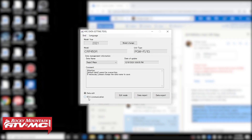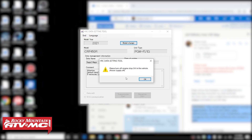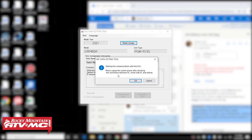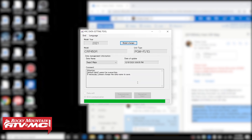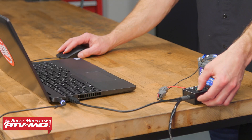What we need to do now is click on the ECU Communication button, then click Transmission Start. So the switch is off — click okay. It's gonna tell us to turn it on, then click okay. It's gonna send those maps over. It says the transmission process was complete — click okay. And we're gonna turn off power to the ECU, then click okay.